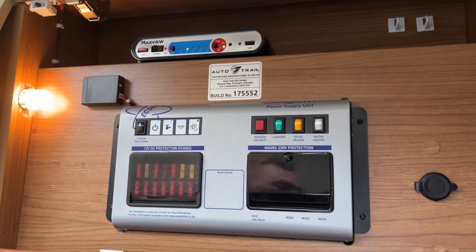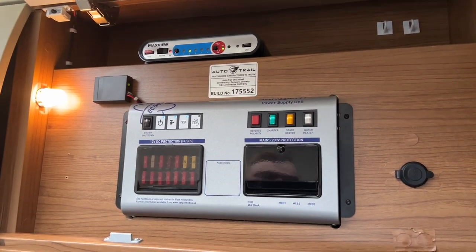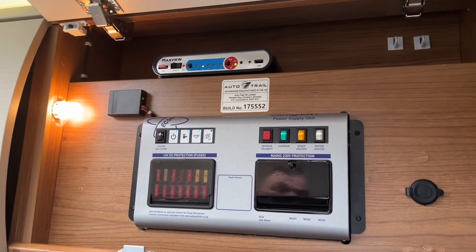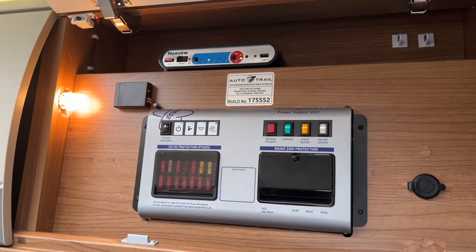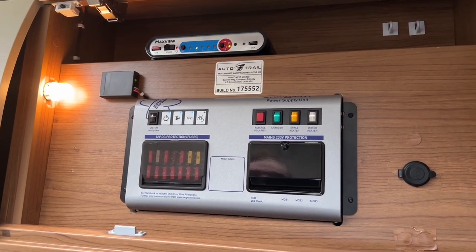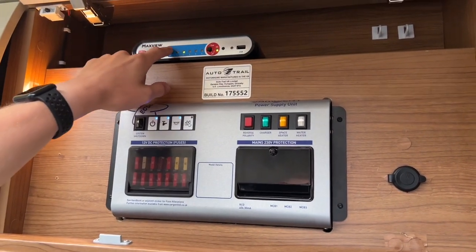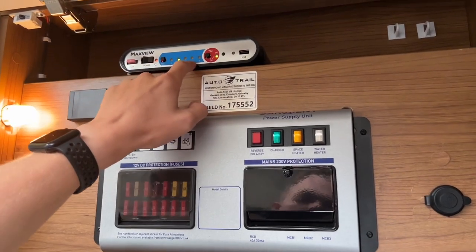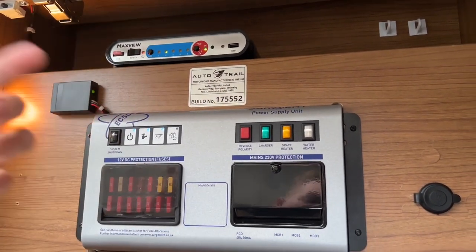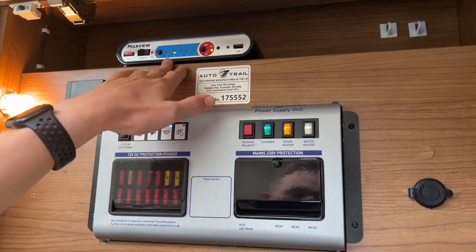Should you ever go to the south of France, into Spain or Portugal, you'll have to change the satellite — Astra 2 works in all of France but as you descend into Spain and Portugal it'll struggle to get a signal. To change it: when it's flashing after turning on, press and hold SAT and move it — there are options 1 to 5. You'll find instructions for the MaxView system online telling you which satellite you need for each country.